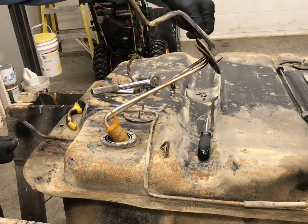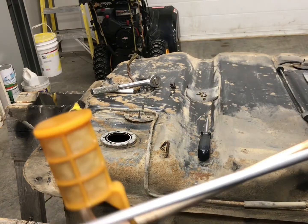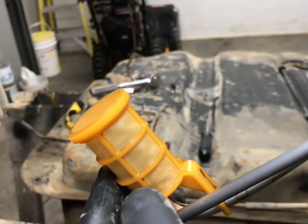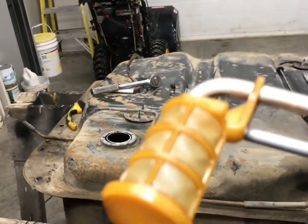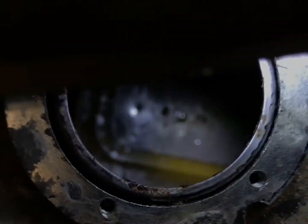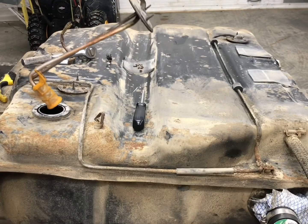Once that's unstuck it pulls right out, and I was really curious to see what this would look like after 30 years of unknown fuel quality. But that filter is clean, clean, clean — it's in very clean condition. I was very impressed. I know this van has low mileage on it, but it still had fuel in it for 30 years. Looking in the tank, there might be a little bit of gunk on the bottom, so I'm going to rinse it out and give the tank a really good rinse before I put it back in, just because I've got it all open.